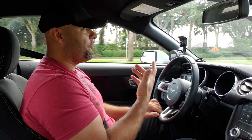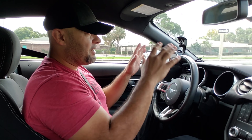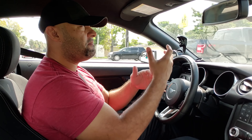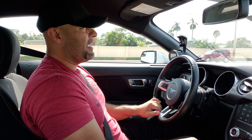Let off — there you have completed 1,500, 2,500, 3,500, 4,500, 5,500 in gear, and you didn't have to stress out about holding it perfectly each time. The log is still rolling, so I'm not going to shut it off. I'm going to find a place to go wide-open-throttle from about 2,500 RPM to 5,500 RPM in second gear, because this is a long-geared transmission with 3.73s in the back and I don't want to end up going 100+ mph.